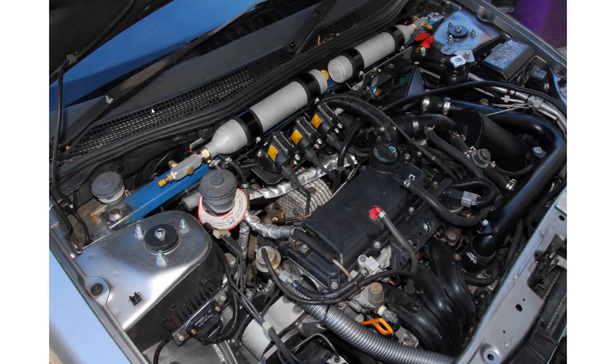Here's the photo of those accumulators. I mounted them under the bonnet — under the hood — which was a convenient place to put them. I actually used SodaStream CO2 containers as the accumulators. They can easily cope with the pressure, they're aluminium, and they can easily be mounted using clamps normally used on fuel pumps. The bigger the diameter of hose you can use between the accumulator and the spring, the better. Unfortunately, the kit springs I'm using on the front have relatively small fittings, but they still do soften the rate of those front springs.